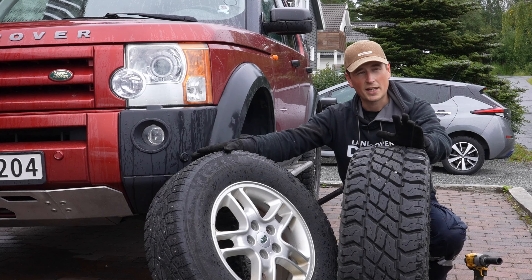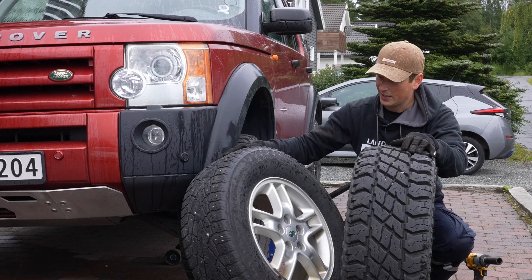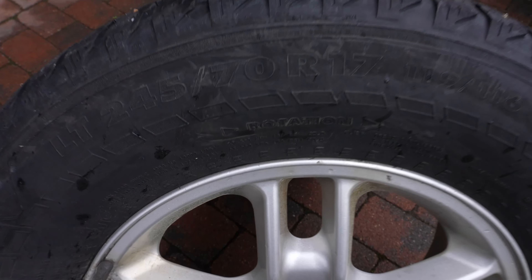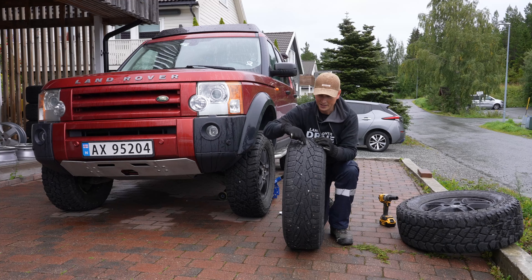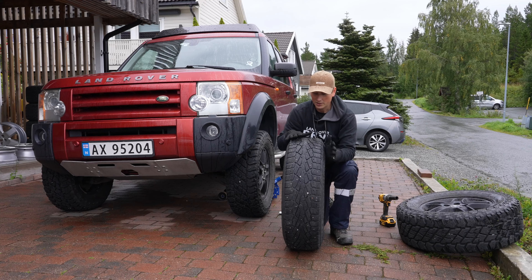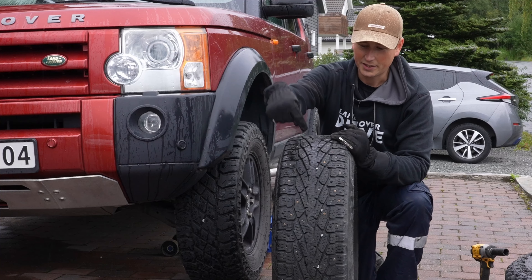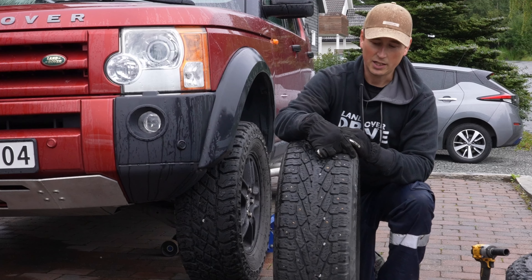When it comes to winter tires and all-season tires — or wet summer tires — you must check if they have a directional spec for the rotation. Often it's marked on the side of the wheel. You can see the tread pattern grooves are in a direction which leads water out of the tire. A tire like this could not be on the left side of the car — it should be on the right — so when the tire rolls down, this middle part hits the water first and pushes it into the grooves and out of the tire.